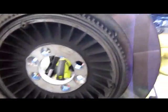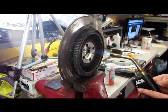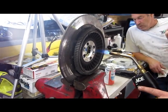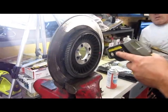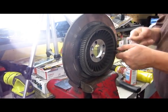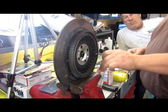You need to remove this — you're going to do the same process that we just did to remove the brake disc. Heat it nice and hot and that'll melt the Loctite. Freeze the bolt to shrink it. Be very, very careful unscrewing this — if it starts getting tight, stop. Reheat it if you need to, but usually if you just hit it with freeze spray it'll shrink back down and come apart.